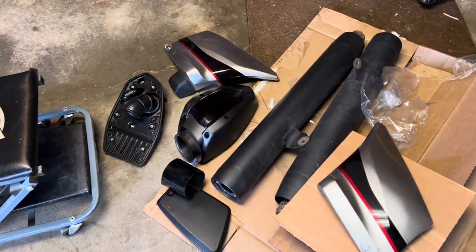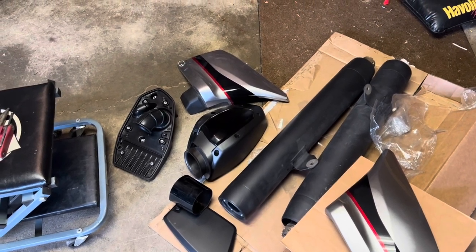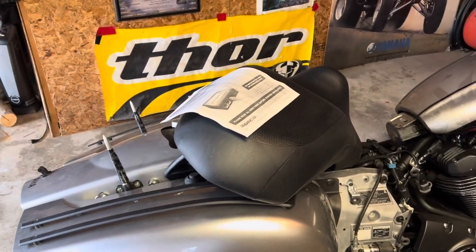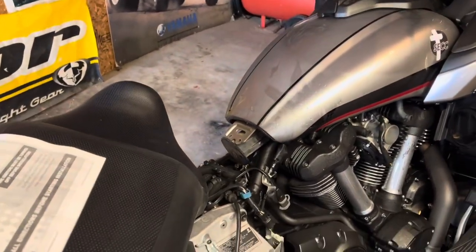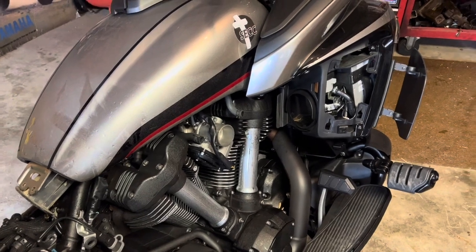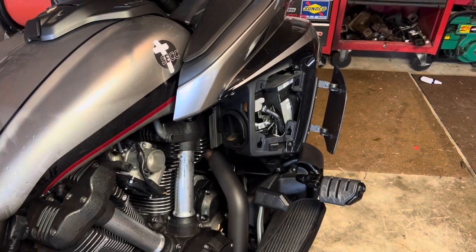As you can see, there are a few parts here on the floor. I went ahead and took some parts off because they're pretty time-consuming and I didn't want you to watch me do that. You've got to pull the seat off, slide that back, pull the tank up and put a block under it, and take the side cover off to get to the seat. You also have to take the entire intake system off.